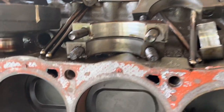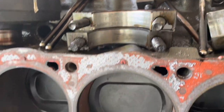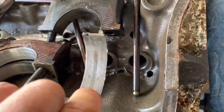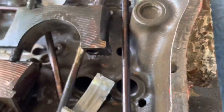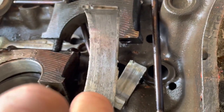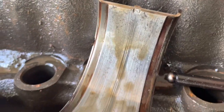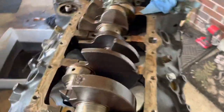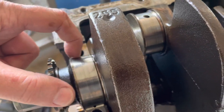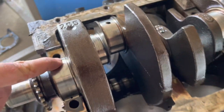These are your main bearings, and it's rare that I see this, but the number one through four main bearings are starting to go out. Here's number two - you see how it's starting to squeeze out the side. That's the cap side bearing which takes most of the abuse. Number three is bad too - the bearing material is starting to squirt out the side and that bearing is gone. These bearings had not spun yet but they would have spun any day. There's number four - not as bad. I can take my fingernail and feel ridges in number one, and I can feel a raised edge where the bearing wasn't riding right.